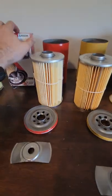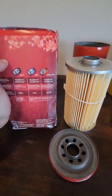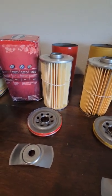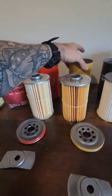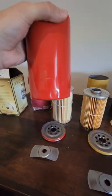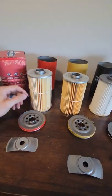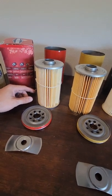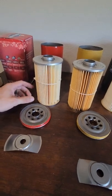Starting with the cheap one: the Purolator L45335 is rated at 96.5% efficiency — so terrible — and it is only rated for 5,000 miles, so I would just avoid this filter altogether. One thing I will say about all these casings that I really liked was the flexibility and the ability to bounce back. Most other filters I have to use strap wrenches to straighten them out to get the filter out, but with these they all bounce back really well with good strength to not collapse as much.